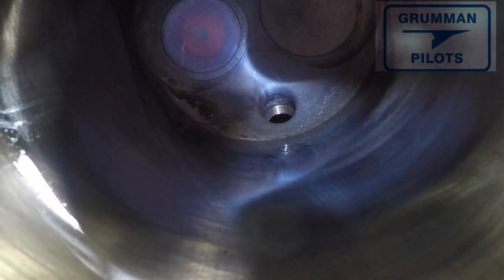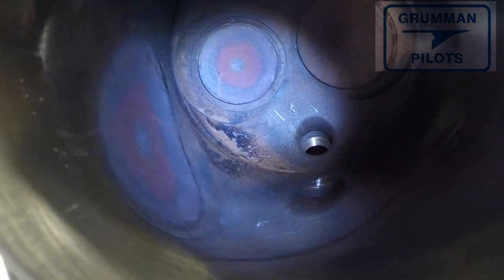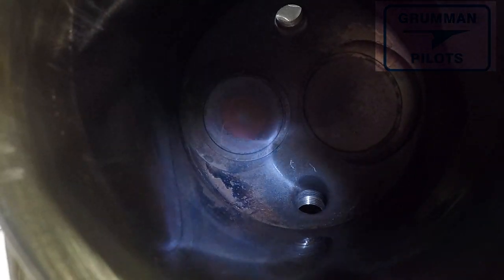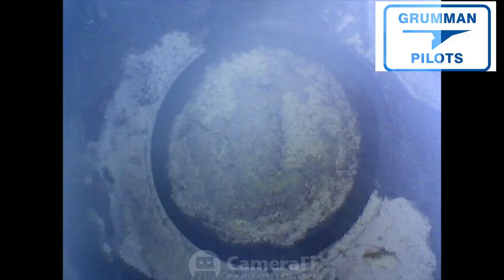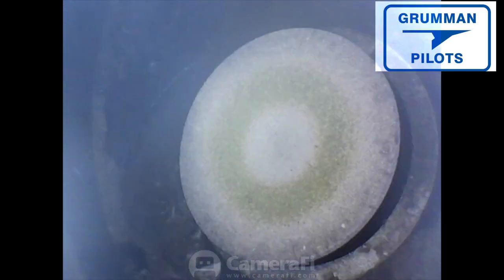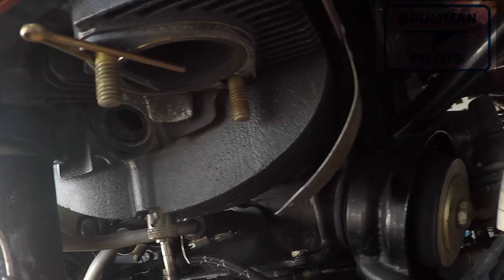This was purely an exhaust valve problem — that's why we were only getting 12 PSI on the valve. It had to come off, go to the repair shop, which was nice enough to repair it overnight. While we have it off, we look at the condition of the valve. Here you can see a picture of a normal exhaust valve from another engine that has not been running lean and has been using 100 low-lead. Watch out for red coloring — that's a lot of heat going into the valve and the valve seat will be worn too. A nice ash-like coating is normal and nothing to worry about.